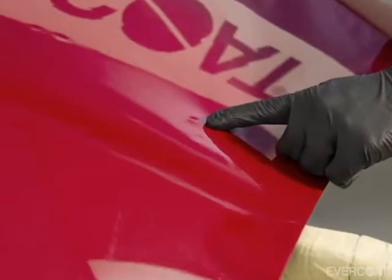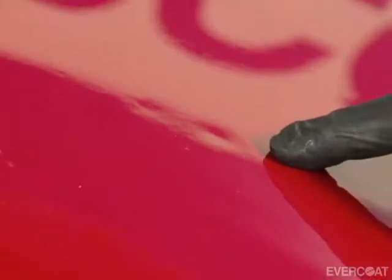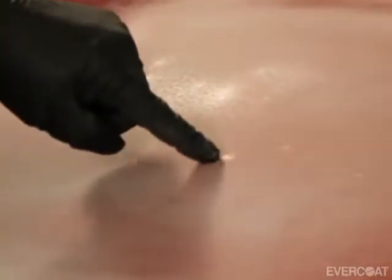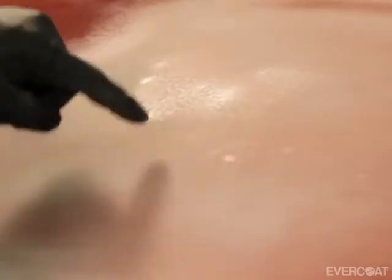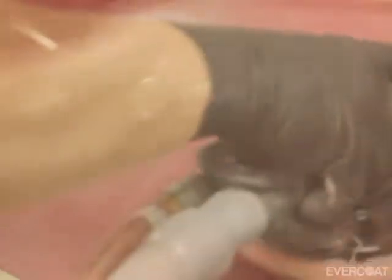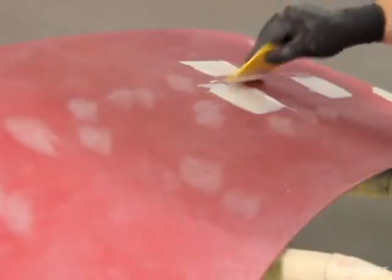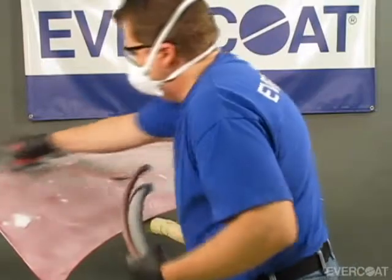When using Finish Sand 4:1 to repair small hail damage, clean the entire panel with a wax and grease remover. Then sand the entire panel with 320 grit. This will prepare the panel and help to show areas that will need to be filled in the process. Now sand the deeper areas with 180 to 220 grit to prepare for the application of Quantum 1 or a premium glazing putty. Allow the material to cure and sand with 180 to 220 grit.